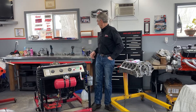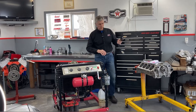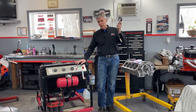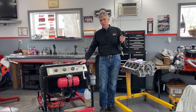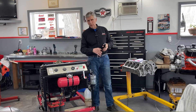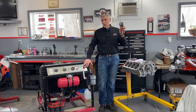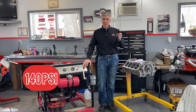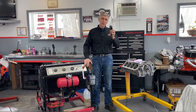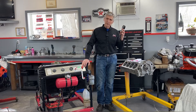When you put a compression gauge in — I have one right here, anybody can afford to buy, it's not a big expensive item — that's the ultimate measure of how your engine is going to perform. Your performance of an engine is directly proportional to cranking compression pressure. We only had 130 psi. Ideally for a street motor, I'd like to see 160 to 180 psi.